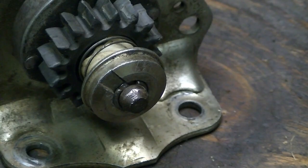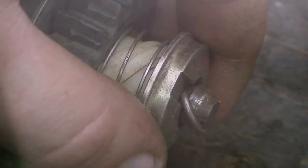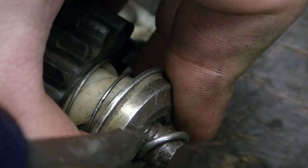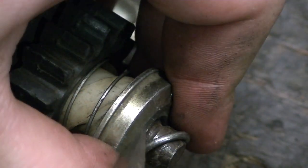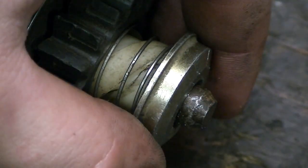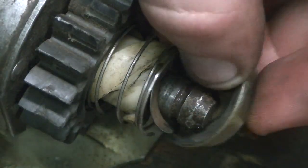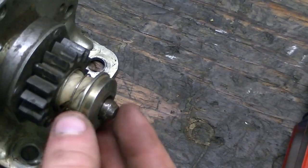What I generally do is just try to pry the snap ring off and bend it up. If you've got patience you might want to try to get two screwdrivers and pop it off. Just keep prying with it all the way around. Watch your fingers when doing this — it's easy to stab yourself. Also wear safety glasses when doing this because you don't want one of those snap rings in your eye.